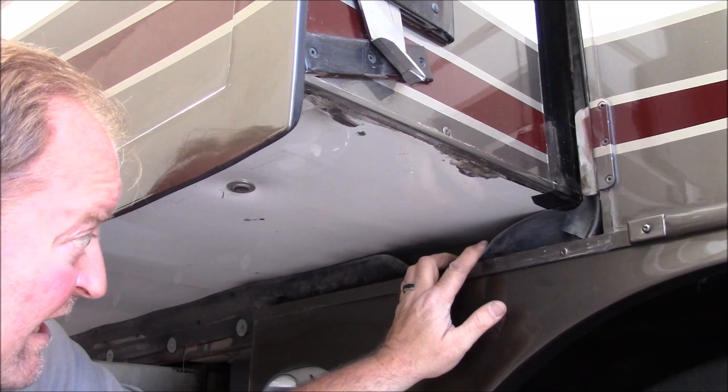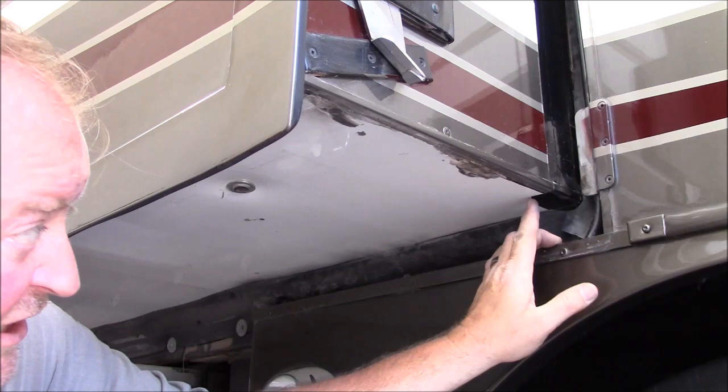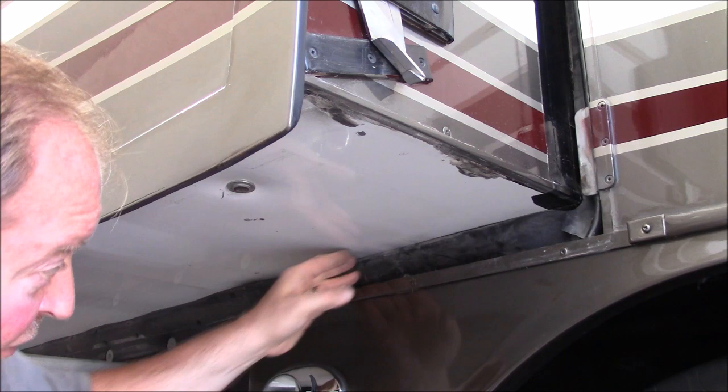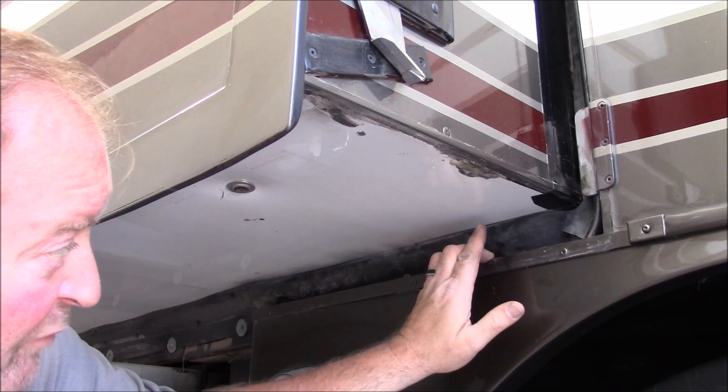Now, if you have your roller positioned closer to the outside corner, you're more than likely going to want to use an RF1200, which will fully encapsulate or fully capture that roller and put the rivets on the outside. My roller, like I said, is 5 inches in, so I'm actually going to use the RF300, which is a 3-inch plate, and then a roller plate butted almost right up next to it for my rollers.